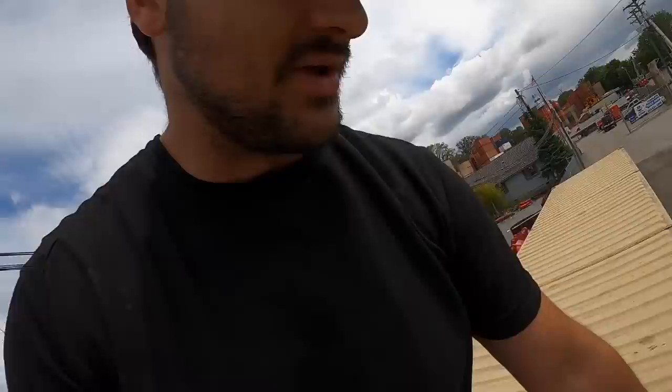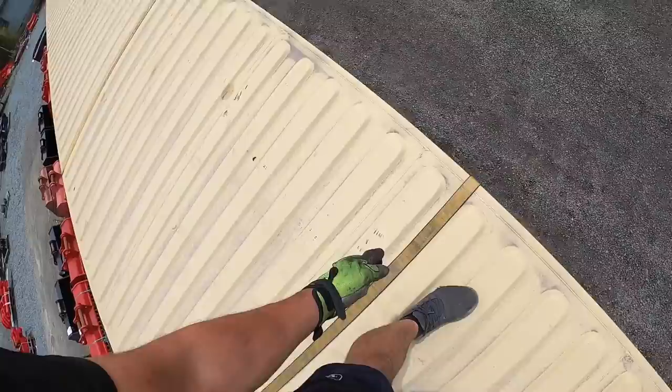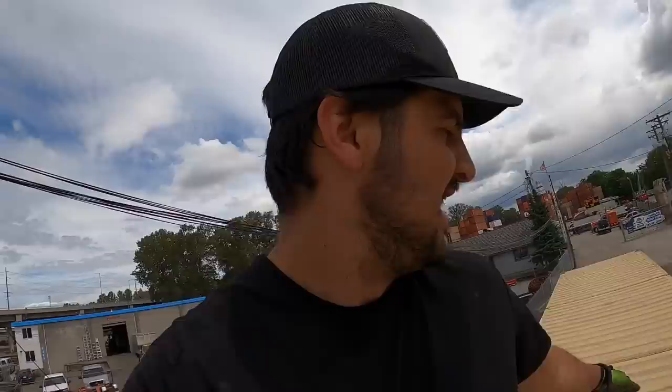When you're on top of the container, you want to be careful. The main reason you come up here is when you throw the straps over, they don't always fly over straight, so you want to make sure looking down that it lines up nice and flat. Give it a half-twist over there and you know it's coming straight, so you only need to do a half-twist when you go to ratchet it on this side. Now we can get down — I did one, two, three, four, five straps and two chains. I think that's more than enough.